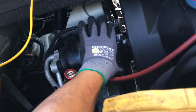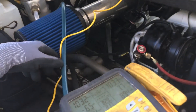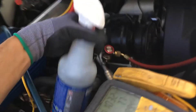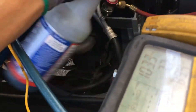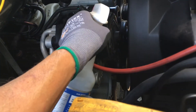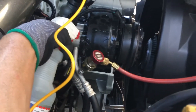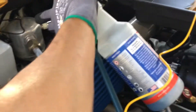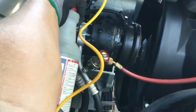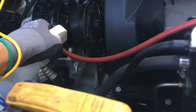If you had the system under vacuum and disturbed it and it started leaking — which might be a small leak only readable with a micron meter, not an analog meter — that's another reason to use a micron meter. If I don't find anything in the obvious leak areas, I'll have to put the camera down, skip to taking out the nitrogen, and put UV dye in the system. Since all this was taken apart, I could have a leak anywhere, but I'm going for the known problem patterns and really obvious ones while I'm holding the camera.